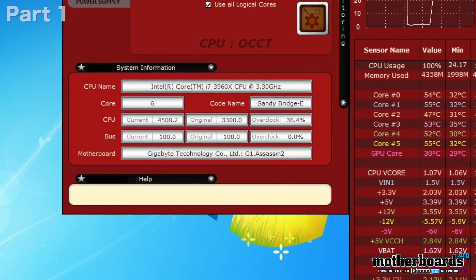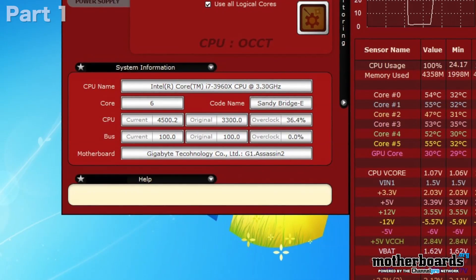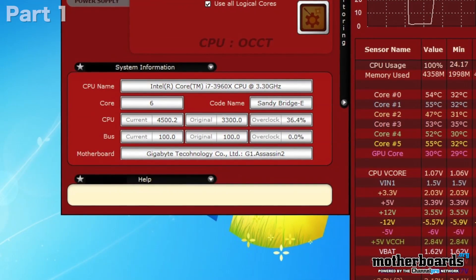One thing I actually did in this video is I went ahead and used something called OCCT. This is how I actually got the system to show the overclock score on all of these new motherboards. If you just go into the BIOS and change the overclocking and bounce into the Windows environment, you're not going to actually see the score overclocked — you actually have to stress the computer to see your overclock. You guys can see from my OCCT screenshots here: 4.5 gigahertz, completely stable, nice temperatures.